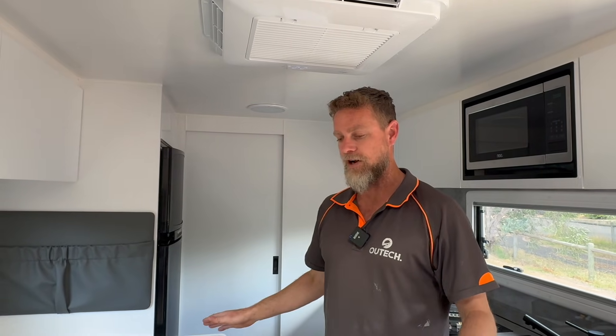If you have any questions about how the system operates, you call us and we give you the answer — because we've done the system, we're not subcontracting out to various other subcontractors. This couple is about to take off on retirement and they're looking forward to picking this van up today. They've ended up with a massive system that has the capacity to run the air conditioner for extended periods, all their kitchen appliances — they're not going to suffer for power. 1650 watts of solar on the roof is a huge amount, and we're looking forward to doing the handover.